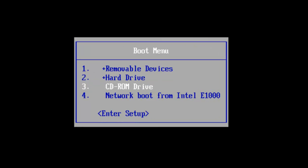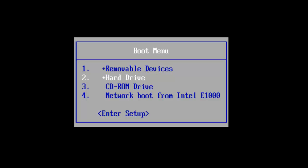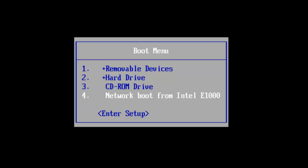But whatever you're using, you want to make sure that you've configured your BIOS to boot off of it. So you just go in your BIOS and look at your startup options and make sure you've configured the BIOS to either boot off the CD or boot off the flash drive, depending on what you're going to use to boot Ghost. Booting and running Ghost from a flash drive.